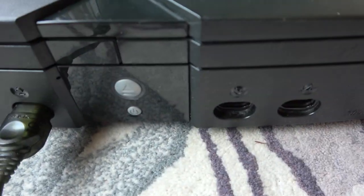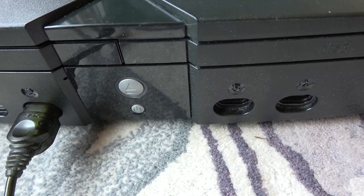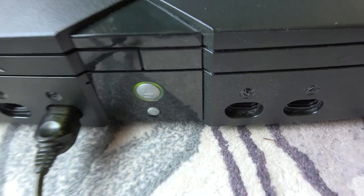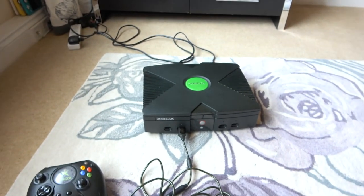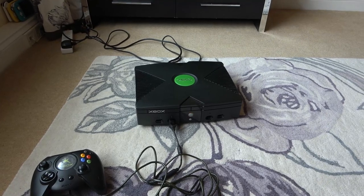You will see we have a green light, it goes off, flashing green light, it goes off, and then it will go to a fast flashing red and green — and nothing's happening on the display. It's definitely not the display cable because I tried it on this Xbox here, which is a working one, and the display cable works just fine.